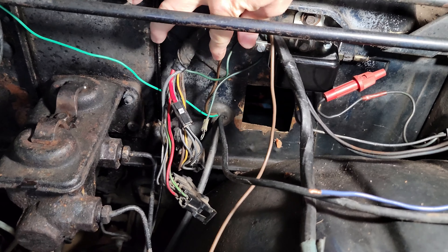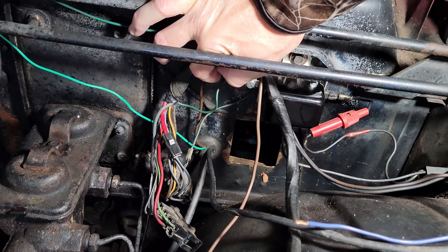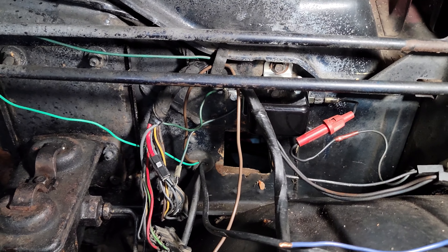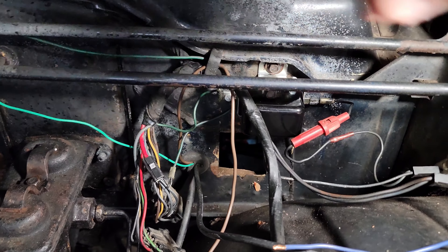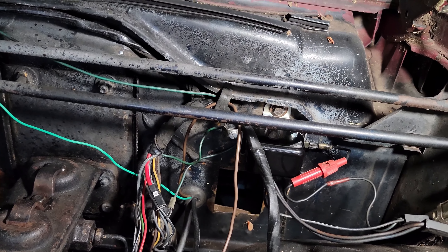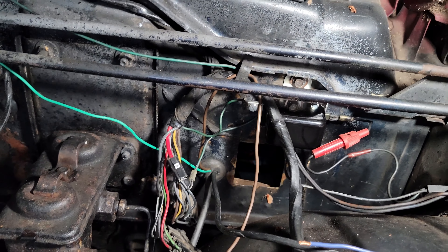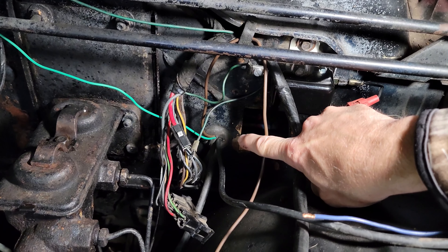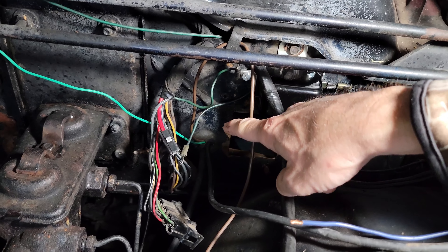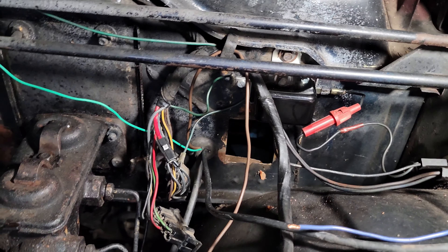You can see the original here — I plugged the original back up. I don't know if they were having continuity issues with that wire and just decided to run a new piece over to the alternator, but I've tested both of those and they seem to be good. If at all possible, I'm going to stick with the original wire and pull that extra wire out. This new green wire is for the tach signal. They already had some holes popped in this grommet here — I don't know what they had powering off of it. There was a red wire and a brown wire going through there already, but the red wire ended up going nowhere on both ends, so I just removed that.